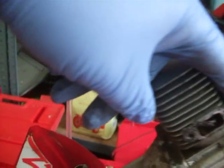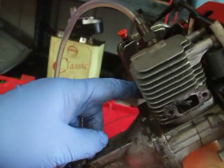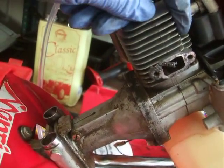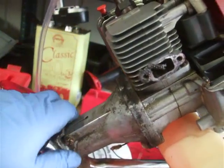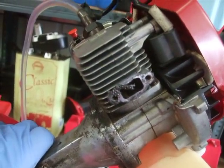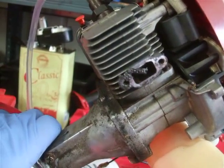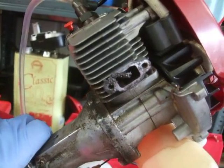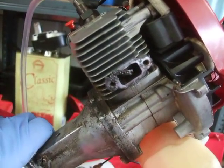As far as I can see there are only two bolts holding the cylinder on. So you just undo the two bolts, slide it off, take your clips off, pop your pin through, put a piston on, put another cylinder on. I'm looking at another engine I need at the moment, so it might be a matter of building one out of two.